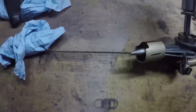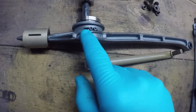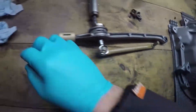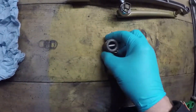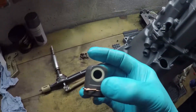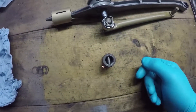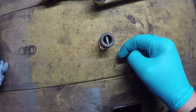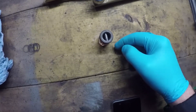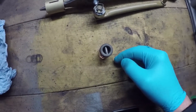So there is the gear shift linkage. We've got the short shifter installed. We need to sort out the bolt hole here — we've got a bit of a problem with that. I need to do something with this bush, which I've got an idea on. What I'm also going to do is take this part here, which connects onto the end of the actual shifter arm with a nylon bush in the middle. Normally from the factory it has a piece of foam at the very bottom. I'm going to use the same polyurethane stuff, flow it into the bottom of that so it gives me that buffer it requires. I'm pretty happy with how the second attempt has gone. That is how you make a polyurethane bush — wrongly to start off with, and then rightly later on.